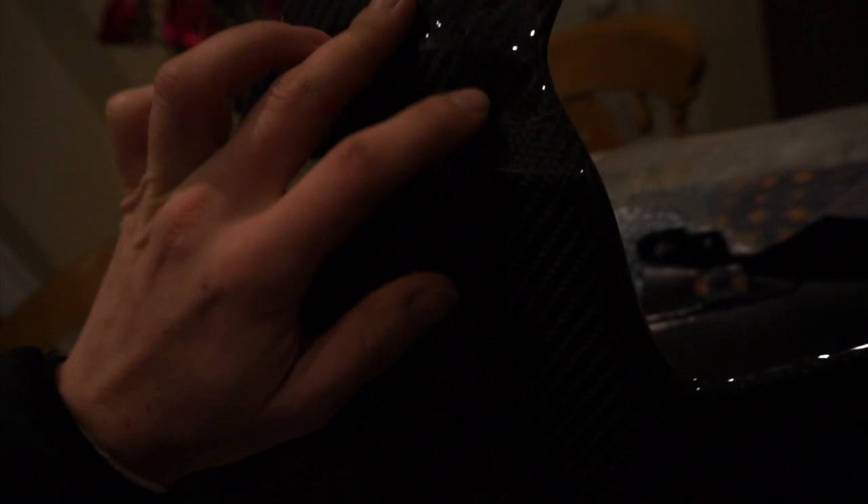It's really dark in here, but basically when I lined it up the gear selector didn't fit underneath this section here. I think that's because I have an aftermarket gear selector from different aftermarket rear sets — I've got the RNG rear sets. So after fiddling with different fittings, the only answer is I've scored a line around here and that section needs to be cut out. I'm going to give that a go with the trusty Dremel and we'll see how we get on.